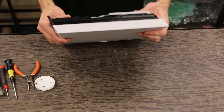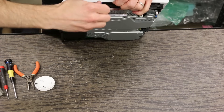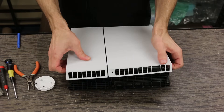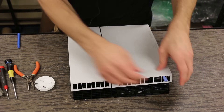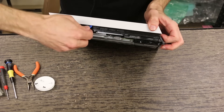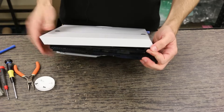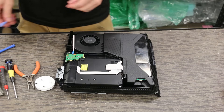The bottom case is a little bit harder to remove on this one. We're going to start about right here and get our opening tool in there. Now that side's off. One thing you have to be careful of is if you're not careful, the other side will snap back on. So I'm going to use another opening tool — stick that in there so now that can't snap back down. We get this in there right in the lip and just go along, and that's going to come off just by pushing this forward as we lift up the back.